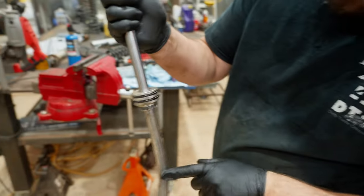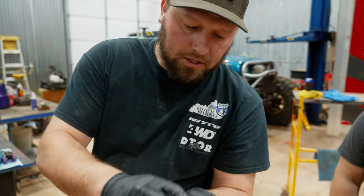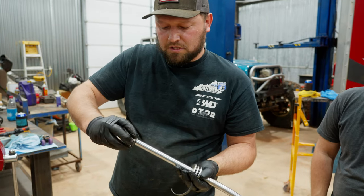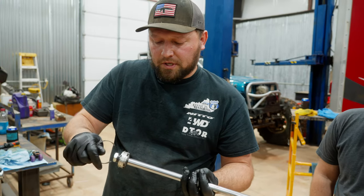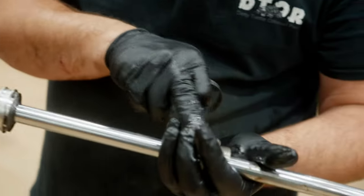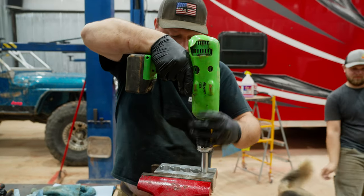So you've got this wear band, and when you bend a shaft your load really changes direction, so you'll start rubbing the side of the piston head against the body. When you're rebuilding these and you have a bent shaft, really make sure that the inside of the shock body isn't scarred up from that, or from any debris, because you might need an actual new shock body too. If you rebuild it with those issues and don't hone it out, you'll just tear through the wear bands and seals and have a leaky shock sooner than you want.